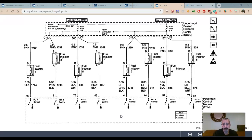contribution testing. All right, this is where we kill a cylinder and we look to see how much RPM drops from that cylinder. If a bunch drops, it was contributing. If nothing drops, it wasn't. There's your dead cylinder. Well, we have the ability to control these, and it says fuel injectors disable, yes or no. That's our choice. So we can shut this off and see if the cylinder goes dead.